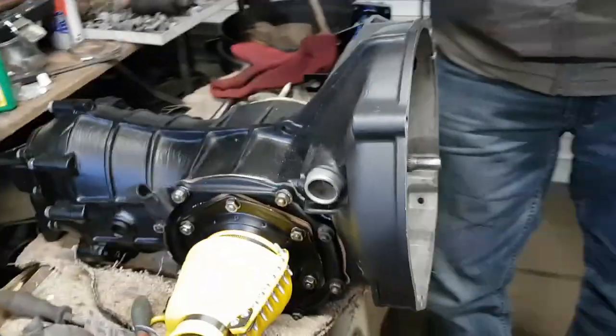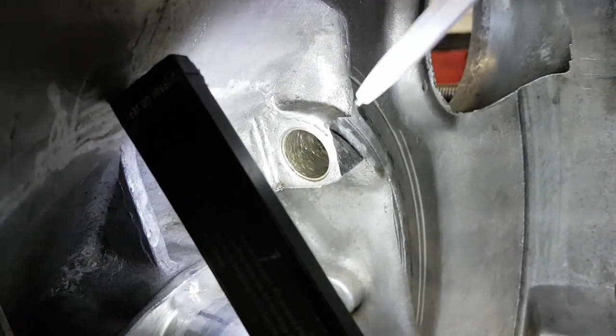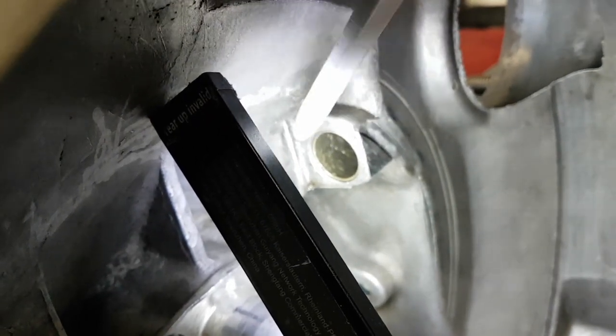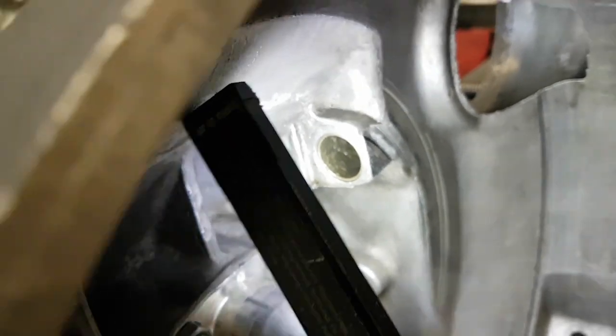And in here — I don't know if you can see — so here we have inside the gearbox, the fork bush. Now this bush here, it looks like an original one, a German one. And see, it has these little blocks inside the bush. Well, in that bush, that is graphite. Graphite, they use in engineering as a lubricant. If you don't have the possibility of having grease or anything to put in there, they put graphite in the bronze bush, and that acts as a lubricant.